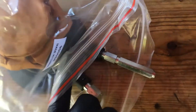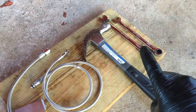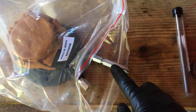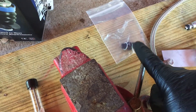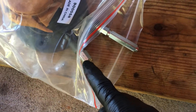The feed line goes on the bottom where the roll pin needs to be punched out, and the bleed goes on the top. I have a hammer to knock out the roll pin. I have 7/16ths and a 13 millimeter. The 7/16th will loosen this one, the 13 millimeter will tighten this one. So I'm going to put this one on for the bleed and plug that one in for the feed.